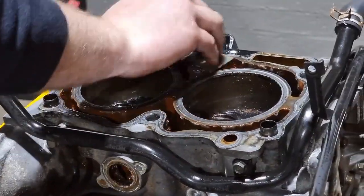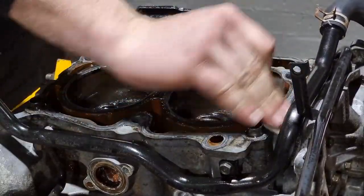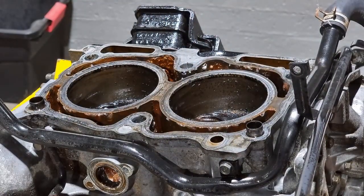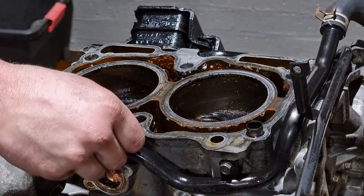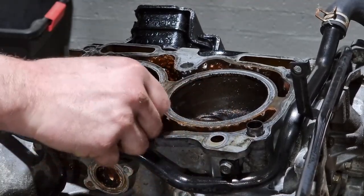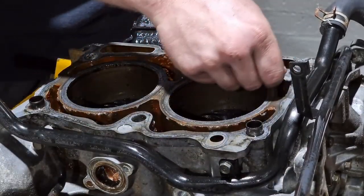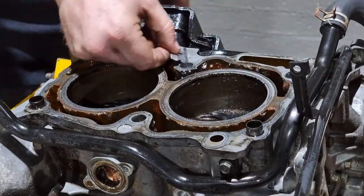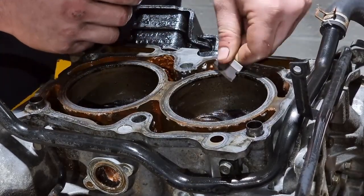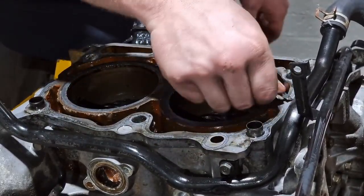There we have the world's most muddy, disgusting EJ block. It looks like they were just filling this up with water out of a horse trough, which probably explains the horrific filler cap on it. As you can see where my hands are, those little ports are where the oil goes through the block to the heads. That is why these engines are known for leaking out of the head gaskets — the coolant and oil always sit in it. And you've got to remember they are horizontally opposed, so there's always oil sitting there, whereas in an inline or V engine, gravity will force them back down — but here gravity is pushing them out of the head gasket.